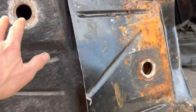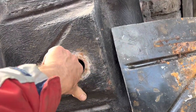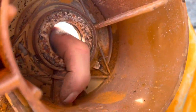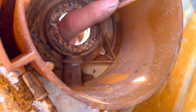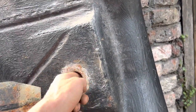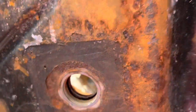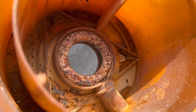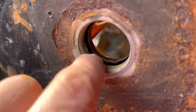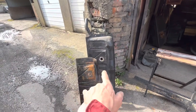Another interesting thing about these two tanks — this is the one that supposedly came with the car, and you can see it's got another patch up here. When you put your finger inside it, it feels different to this one here. You should be able to feel the inlet pipe and this vein, but I can't feel that inlet pipe, which makes me think this has been modified in some way. Also, on this tank there's a metal piece where the return tube comes in, and I'm not sure if that gap has just rusted away. I've made my mind up — I'm not going to try and use the original tank; it's been repaired too often and I don't know what's been done inside it.